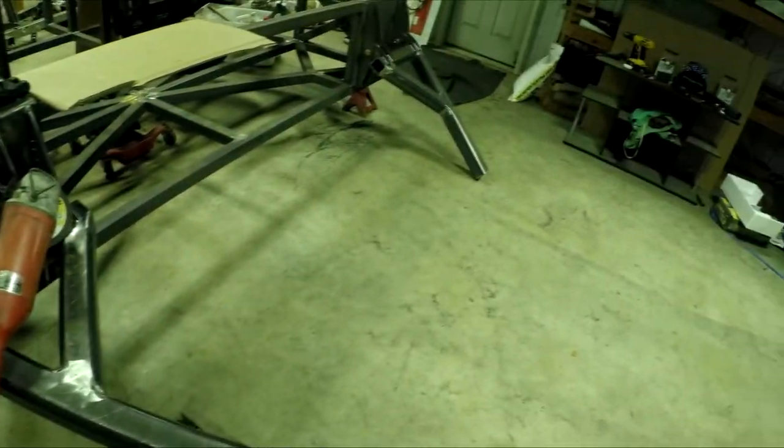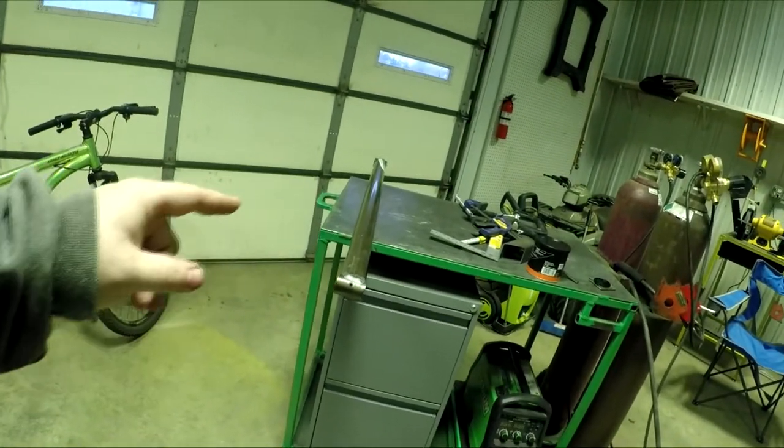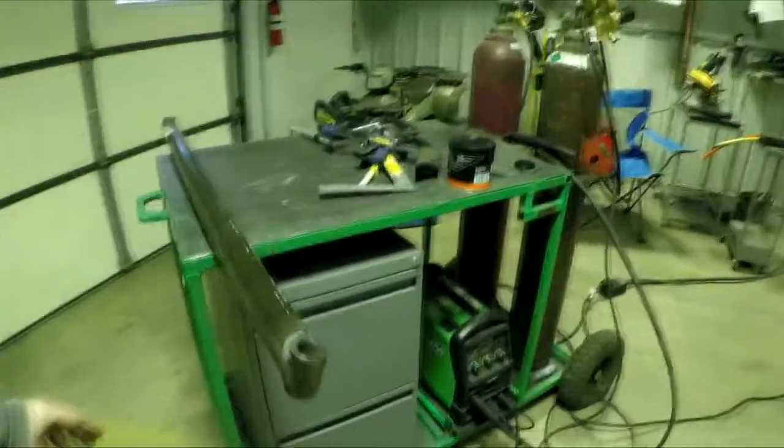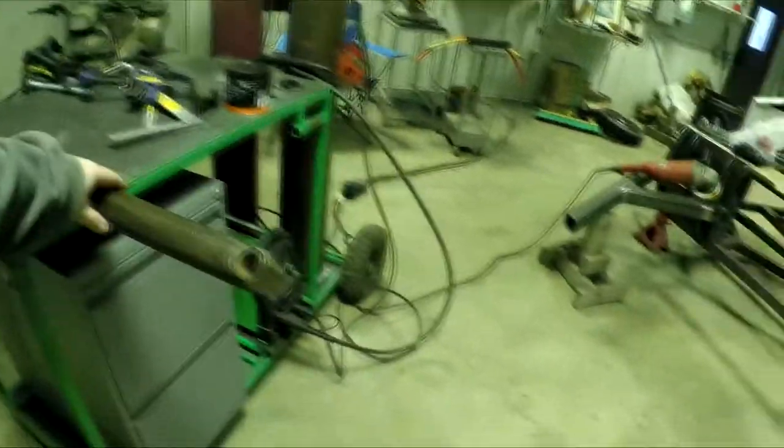So today, as you saw, we're going to be putting the front axles through the A-arms. Today, I'm just going to work on assembling the spindles and the rotors, getting the wheel bearings packed and greased. And then I'll probably take it all off, set it aside, maybe wrap in some plastic so it stays nice. And then I'll chop this up, cut my holes, do my welding, and I should be able to put this back on and it'll be ready for wheels and tires on the front.